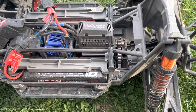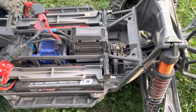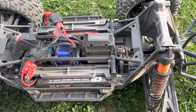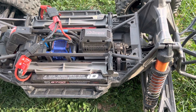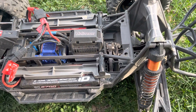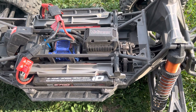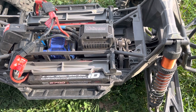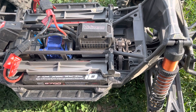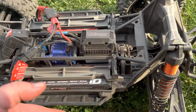I'm going to try to stick one of the hardened steel ones back on there since the pinion seems to be staying. I recently found out there is Loctite 242 and 243 in the blue, so I'm going to try to find some of the 243, break-clean the motor shaft, and just let it sit on there for a day. I am at a loss — this was running pretty good for a minute, but I can recognize the sound immediately; I heard the teeth break off, and the hardened steel ones stripped out today too.